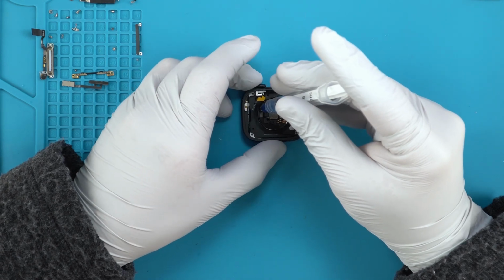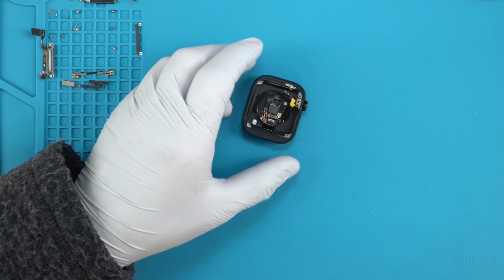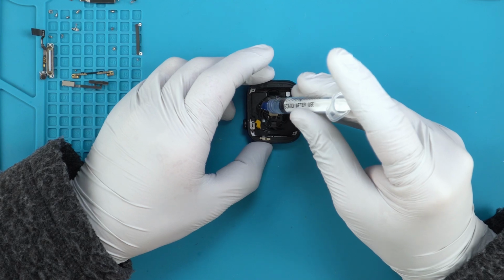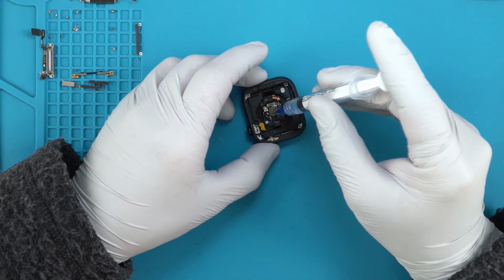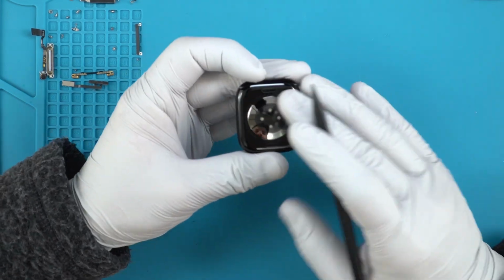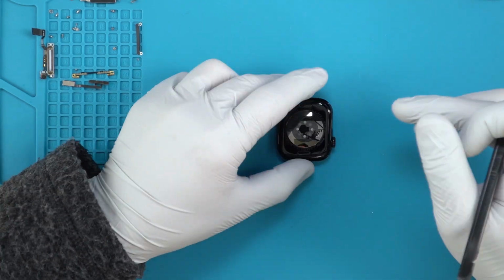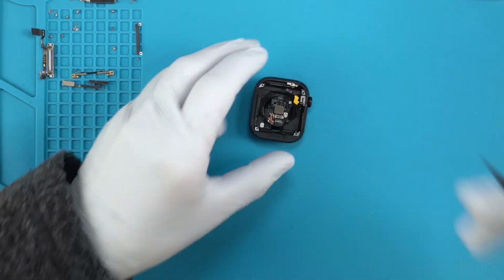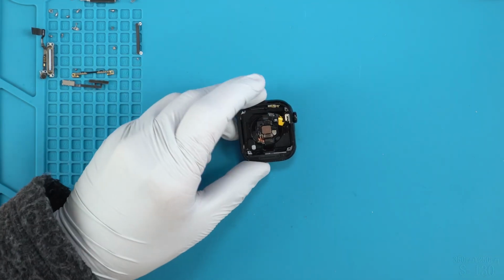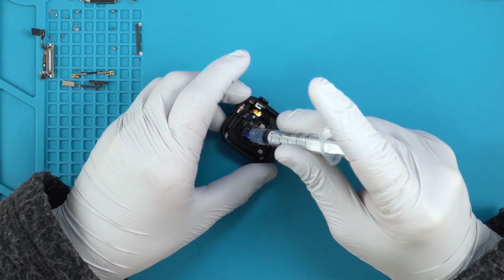It could be slight adhesive, but it's probably friction pressed in with maybe an adhesive as well. So this might be a little tricky, as we'll probably need quite a bit of force to pull it out. But again, it's glass, so you can't put too much force into a single point. Because I'm assuming when they press it on, this whole area will be covered and will be like so, and then they'll just friction fit it right in. Similar to what you would do on glass for an actual watch, but that's speculation on my part, it could be different.